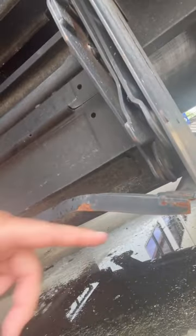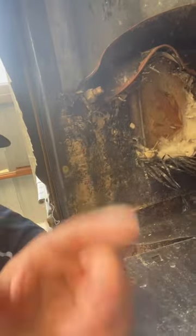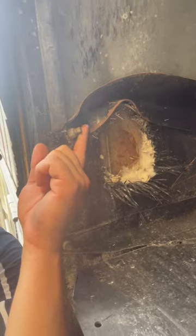This happened too. It bent this angle iron, and now my steps won't fold out. It also put a hole in my underbelly — that's the subfloor right there. These are all fixes I have to make, including this frame bracket here that's also destroyed — all because I didn't take the time to check that my tires were rated for the camper I had them on.